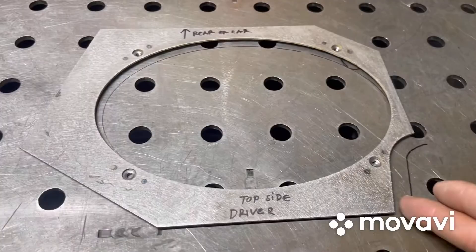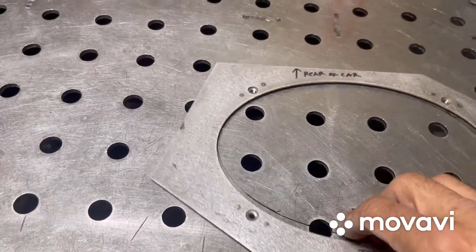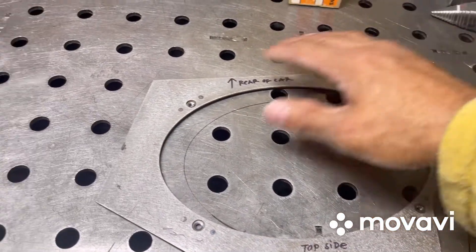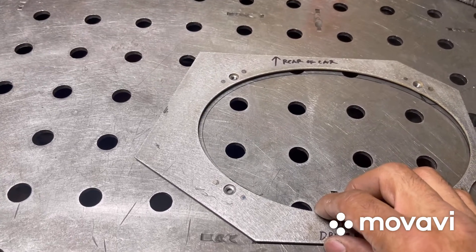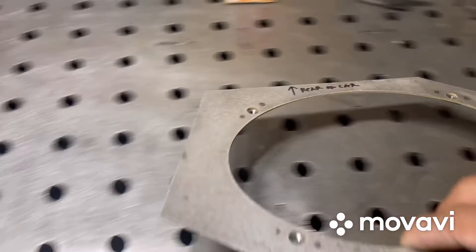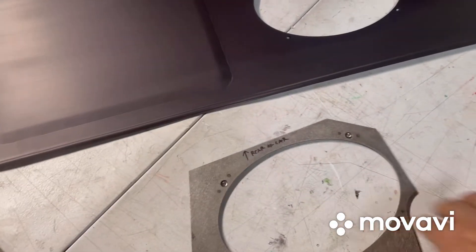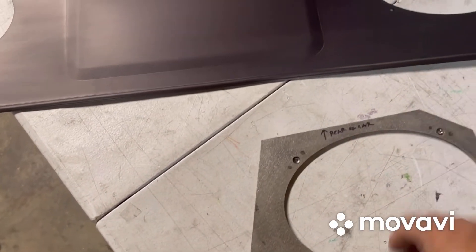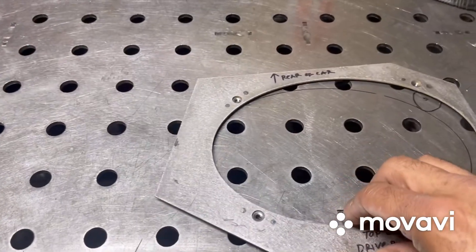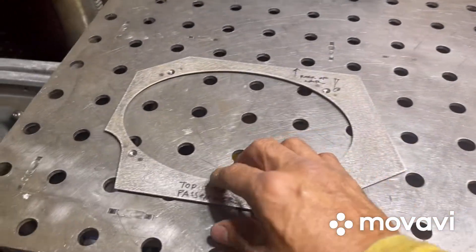There's a driver's side and a passenger side — they're opposing each other. See that curve? That curve is on the opposite side. Cut these off, drop them in there, bring them flush and tack away. I suggest before you do that, you probably bolt and screw them onto the bottom of the package tray on both ends and bring the whole package tray as a unit and drop it in there together.